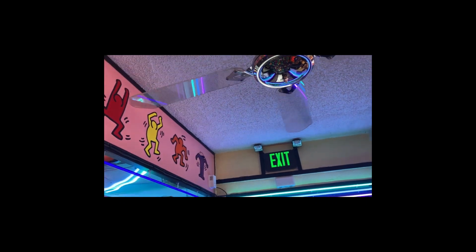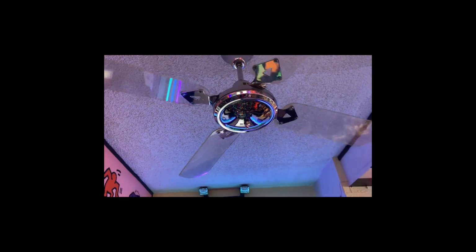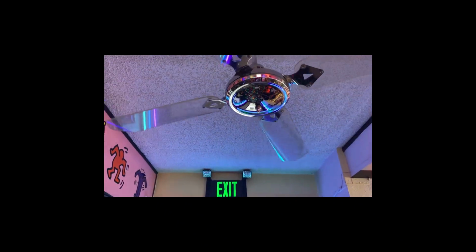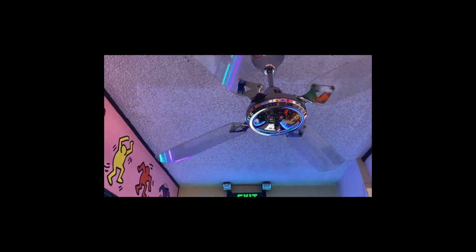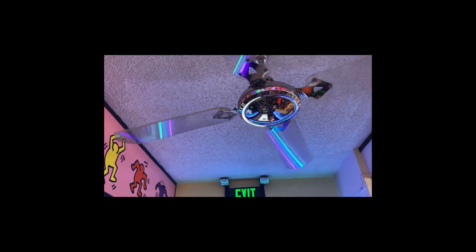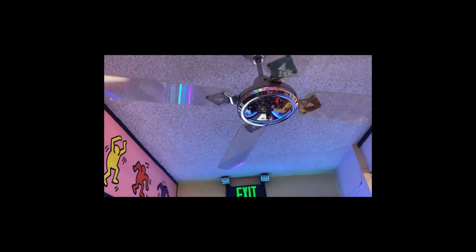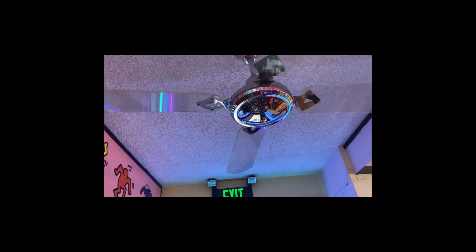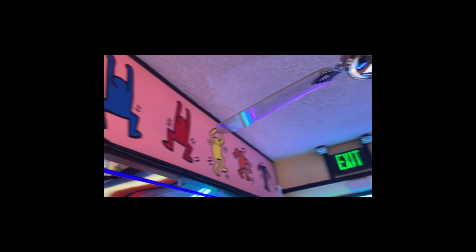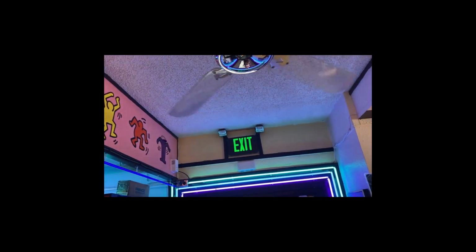Yeah, it's a big round one. Because I had a Pelco I restored, and I just put in a modern 5 because it had an oil-filled 4.75. When I restored it, I put a new one in, and I just put in a 5 because at that point, a quarter of a microfarad on the ceiling fan motor won't make a difference. It's electronics that'll make a difference, but on the ceiling fan motor, it's barely a difference.